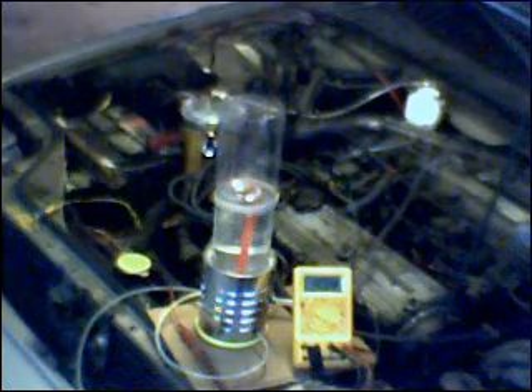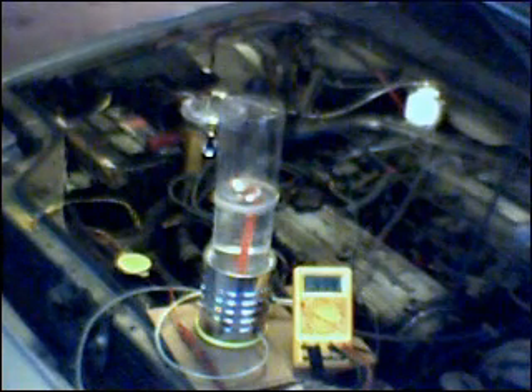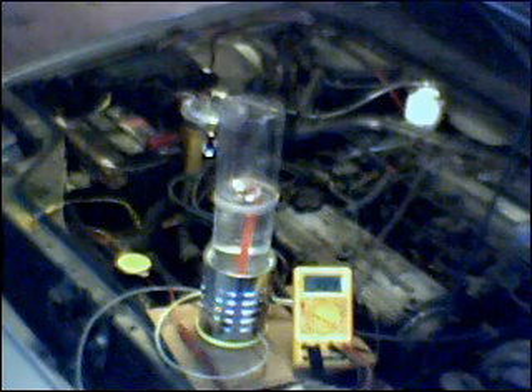Therefore, when I install the electronic fuel injection enhancer, my baseline value that I'm going to start with as an offset voltage will be 100 millivolts, and I'll probably work my way up from there to make the mixture a little bit leaner. And that will be my starting point.